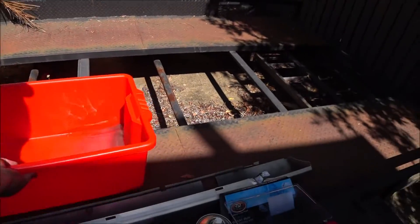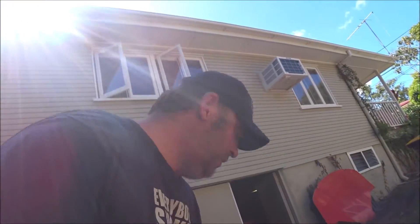Let's give you a look at what is in the bottom of this tub now. See that debris, the dirt — this tub was clean, so all this metal and dirt and gunk was all inside the oil passages inside the crank. You can see why, although this is a bit of a fiddly step, why it's worth doing. I've spent so much time and effort on everything — to have that debris go through the oil into the journals, bearings gone, game over. I don't want game over. I want this engine to last quite a long time, so that's why I'm taking these extra steps.